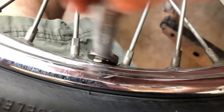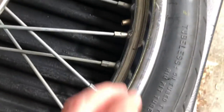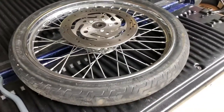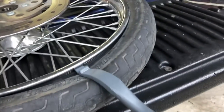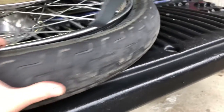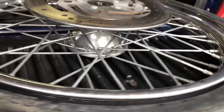This 12mm wrench is used to loosen the nut on the inner tube so you can push the valve stem back through the rim and take out the inner tube. A few things to note: some tires are balanced. There's usually a yellow-red dot on the tire, and you'll also see the rotation direction marked. You want to line those up, make sure rotation is going the right way, and that the balancing dot is at the valve stem. The next step is to break the bead — place your tool between the rim and the tire and press down to draw the tire away from the rim. Do that completely on both sides before you try to remove the tire, otherwise it's going to give you a real hard time.